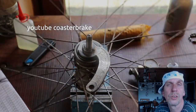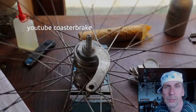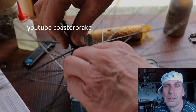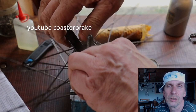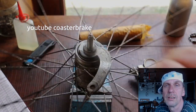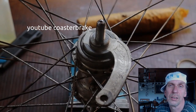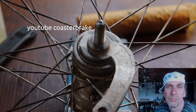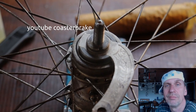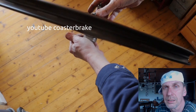This shows how I work for the play of the two great ball bearings next to the hub shell. I draw the wheel in the vise, hold the axle in the vise, and lock the lock nut. If you wobble the rim, you can hear a little play, and this is a good result.